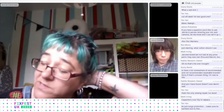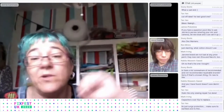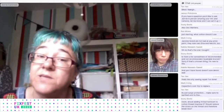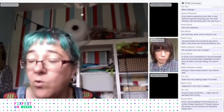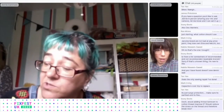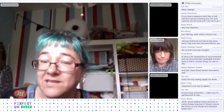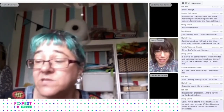So this is what I always say about vintage sewing machines. Don't leave them plugged in, because when you're not there, or even if you walk out of the room, I once left a machine literally to go and make myself a cup of tea. And I came back and it was sewing on its own, because when those capacitors go, it starts shorting and the whole on and off thing gets bypassed. I know someone who just kept turning the machine off at the socket in order to stop it sewing. And she left it for ages until it eventually caught fire. So don't do that. Don't leave your machine plugged in.